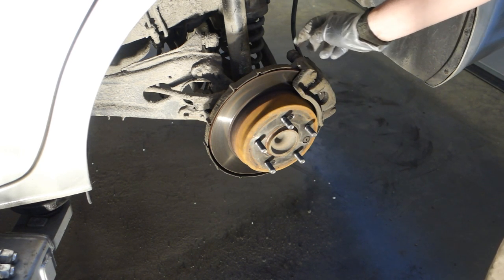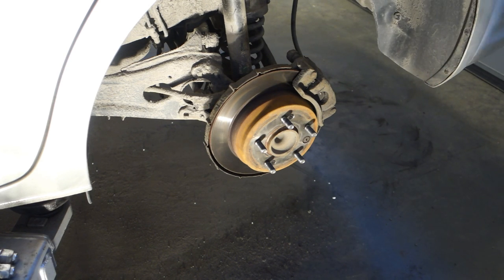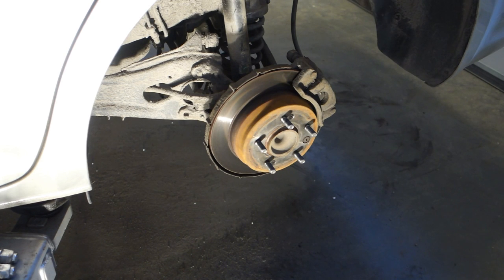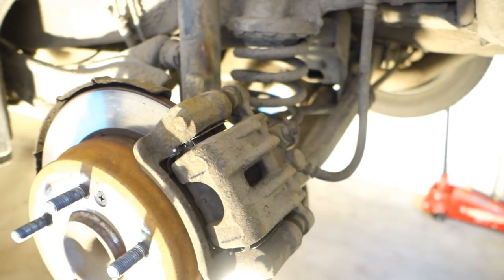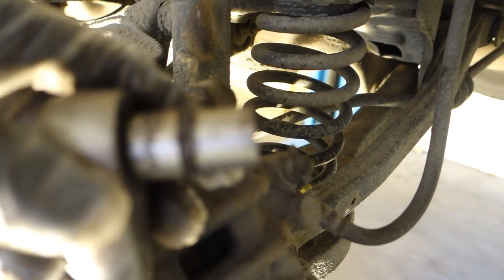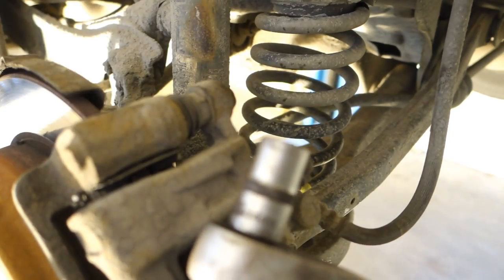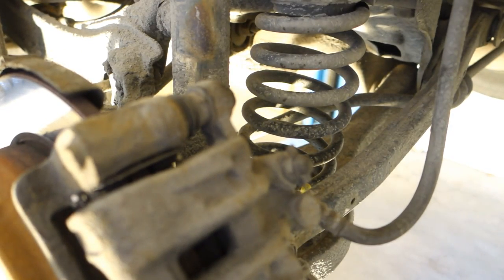Here we have those brake pads, and then there are bolts in here, and let's look at those bolts next, and we need a socket also. Okay, and then it's time to open these bolts, and there are two bolts, one in here and one lower, and for that job we need this 14 millimeter socket that I have in here.